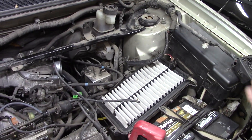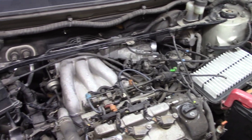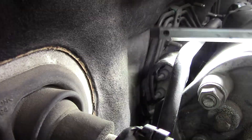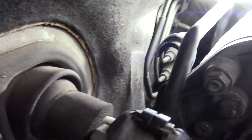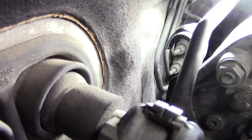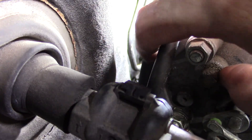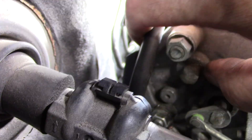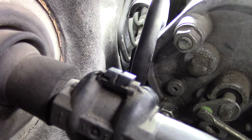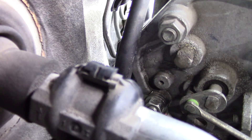With the air box out, we need to move an ABS relay and then remove the entire upper intake plenum. But there's a sway bar strut stabilizer bar in the way — we'll remove that. Then comes one of the first real frustrations: a U-shaped support bracket for the upper intake has a bolt recessed into it. You can't get a flat wrench in because of the bracket's shape.